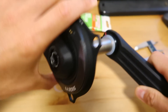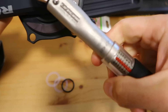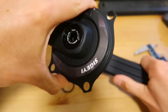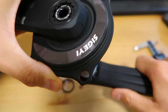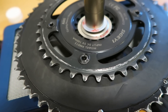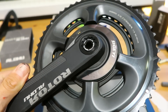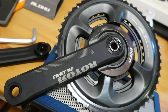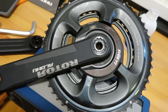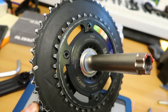At 24 newton metres on the small torque wrench, there's still a discernible play in the chain ring spider and power meter — that's absolutely not good, and it'll give pants chain ring stiffness. That just shows how important the 35 newton metre torque spec really is. To get up to 35 Nm I had to put this in the bike to get enough purchase to react that torque with the bigger torque wrench. Done up to 35 Nm — and there's no play left in the chain ring spider or the power meter. That goes to show how good they are with tolerance on this taper: with such a fine taper, if the male taper was slightly too big, no amount of torque on that crank bolt would ever compress the chain ring spider. Rotor have really nailed the tolerance and achieved something quite difficult to do in mass production.